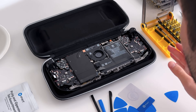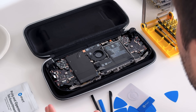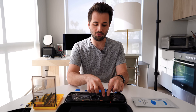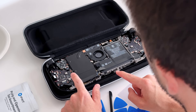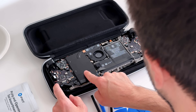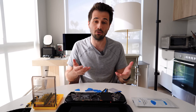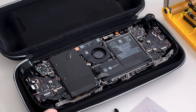Basically at this point, bring your attention to the back shielding plate here. What we're going to do is remove this. In the old LCD you could just remove it and pull it off, but note that we have this ribbon cable that is actually glued to this back plate, so I don't recommend removing it from there — I would recommend working around it. There's also a little wire on the other side; you want to work around that too.